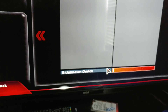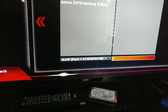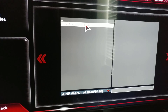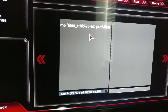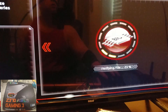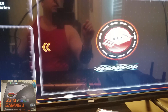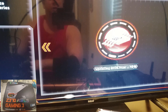Over there we've got our thumb drive ready to go. I would click on this and then search for the device, which is the HP thumb drive. Then I would look for my BIOS, which is right there. At this point I would click on that and then hit this button over here to actually run it. We're going to click this button and she's going to update. Whatever you do, do not leave or reboot your computer while this is happening. I'm going to keep recording because something will happen towards the end of this and every time I pause it, I miss it.